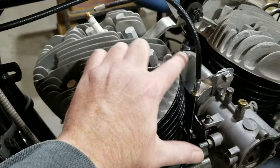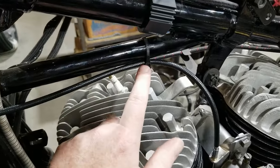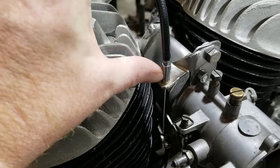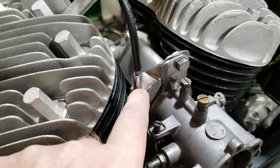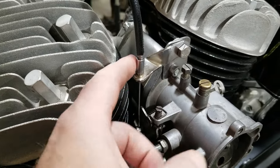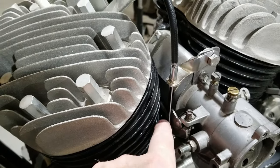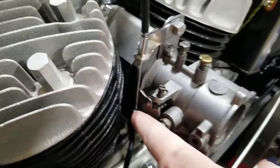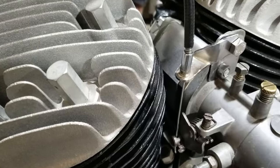It made more of a 90-degree turn right away. With it being up here and wire-tied under this lower part of the backbone, it actually becomes more of a later curve and a straighter kick down into the carb. We even added this extra bracket just to pick it up a little bit farther. The whole theory was just to get this to be more straight when it pulls instead of all bent and curved right away. We noticed that when we just had that bracket on, it was binding.